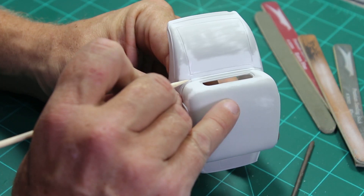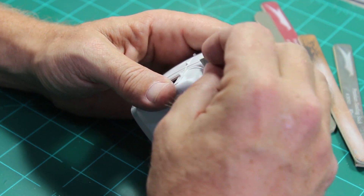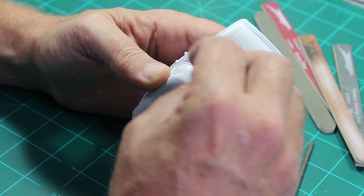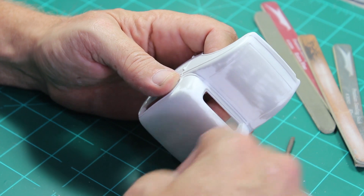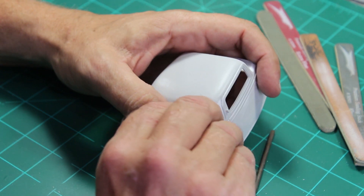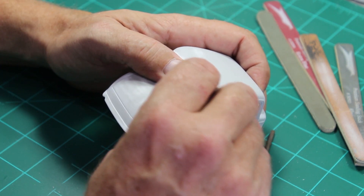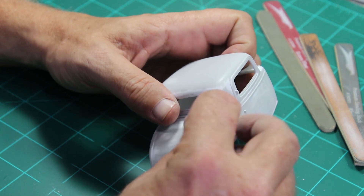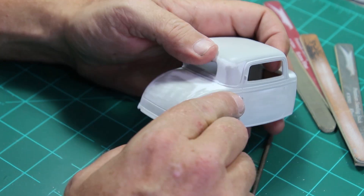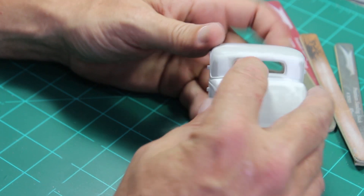Let's see if we got rid of that. It's just a little hair of a lip there. Still trying not to press too hard — just trying to get rid of that as gently and softly as possible. Right now I'm using the 400 grit. I'm still working on it. That's pretty darn close. I'll just fiddle with it a little bit more and then call it good, because you're really not going to notice that lip once the paint is on there. This is not going into any kind of competition, so I'm not too worried about it. I'm more worried about losing that round on the moldings — I just want to lose the lip, and that's actually fairly good on the top. The middle is definitely gone, so now I get to do the other side.